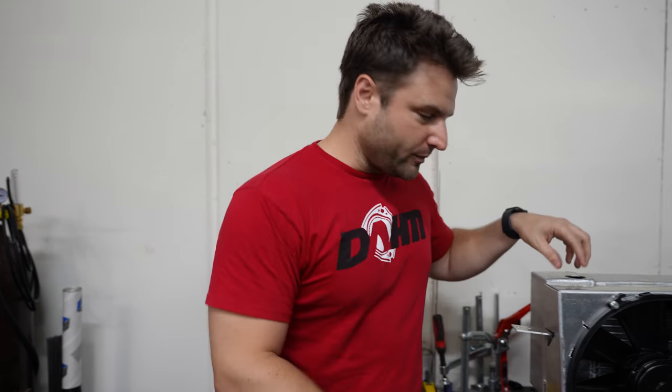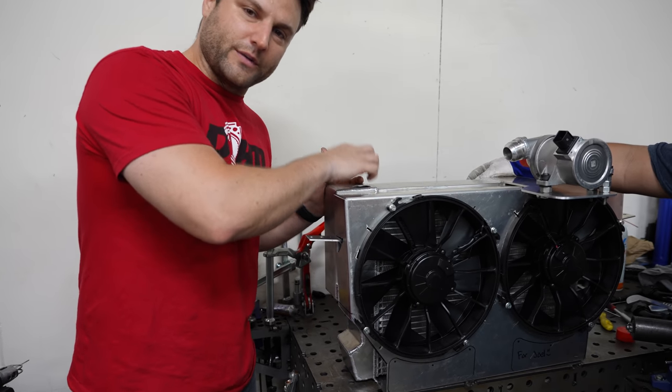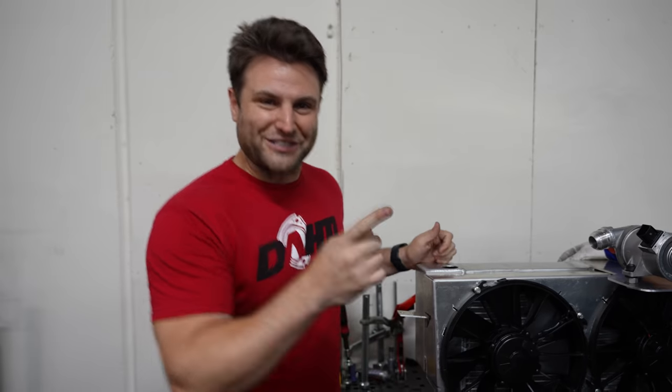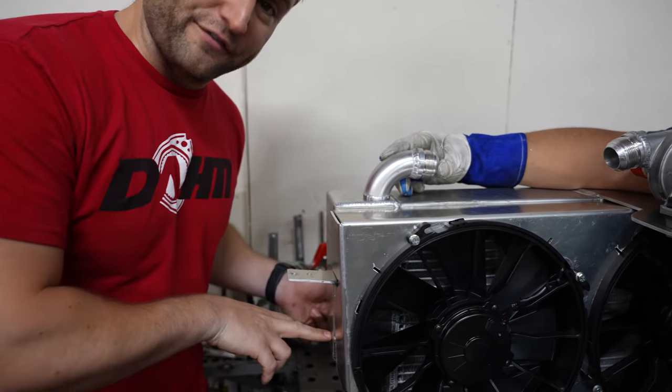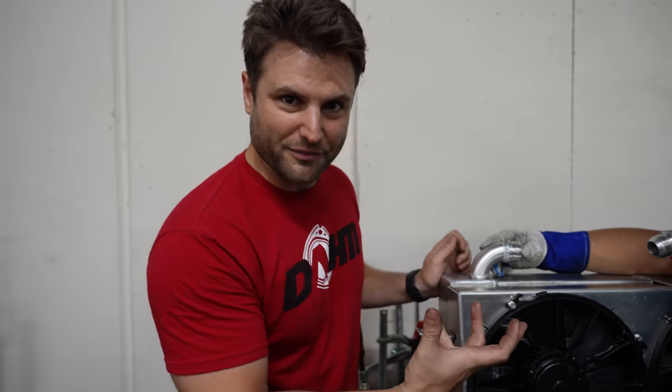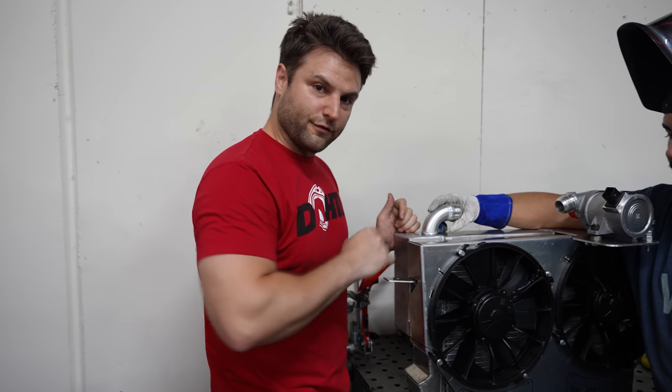Life has a weird way of throwing you curve balls, but there's always a way to solve them — either starting fresh or looking at your current limitations. What would be the problem with pulling coolant from the top of the radiator? Most people say 'oh, that's the hot side' — but the real problem is air. The top is where air rises to, and we do not want to pull coolant from the top because that could cause air to go into the pump, and then the pump spins and doesn't produce a vacuum. We're still going to pull from the top, but we have a little internal solution — a tube that actually pulls from lower, almost below halfway inside the tank. So even if air collects over time, that air is not going to affect the water pump.